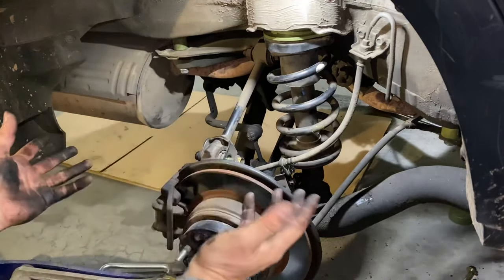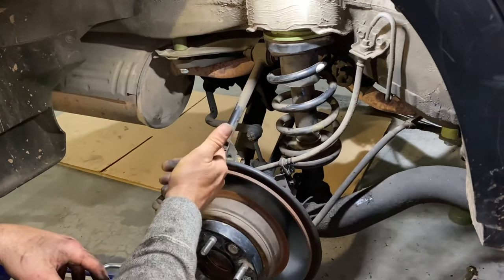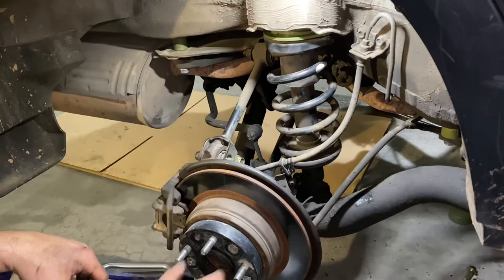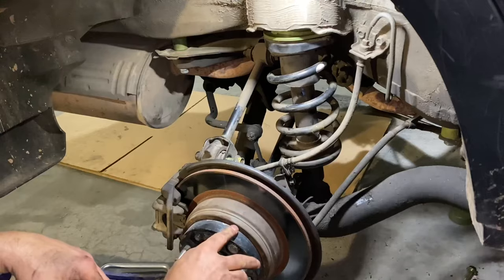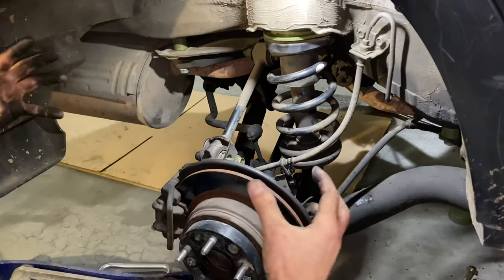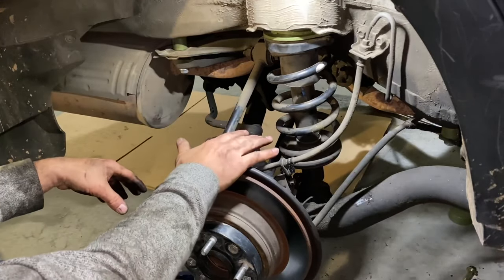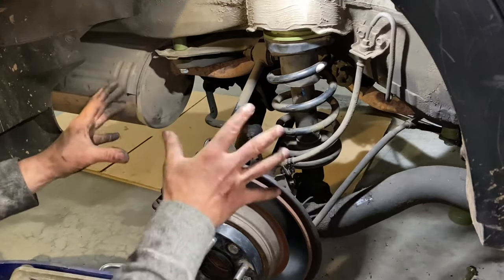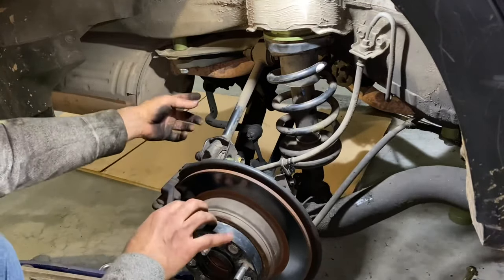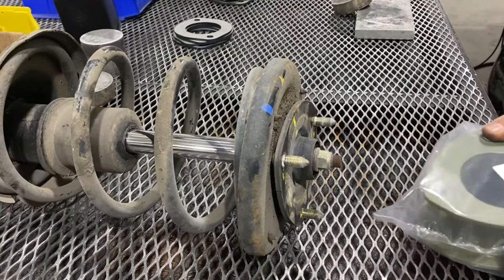After this, that's pretty much all there is to it. Obviously we're going to tighten all the bolts — you want to torque those to spec if you're so inclined; you can find the factory torque specs online. There is one other thing to mention: tighten everything up in the suspension's resting state — in other words with the weight on the vehicle. We're going to put the wheel back on, loosen all these bolts that hold the bushings, and then re-tighten it all.